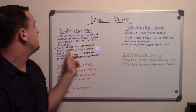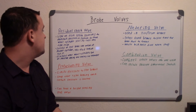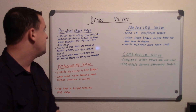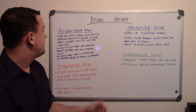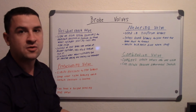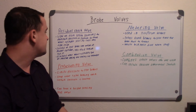They're located at the rear brake line outlet at the master cylinder, and that's because drum brakes are in the rear, so it will be at that one that goes to the rear brakes. It lets fluid leak out and not in, so that way if you get a leak in your system, only fluid will go out and air won't come in. You don't want anything to come in — you definitely don't want air in your brake system.